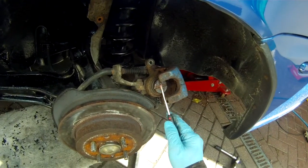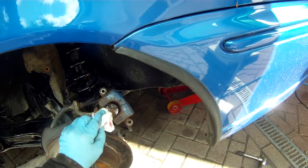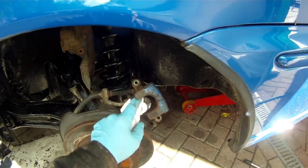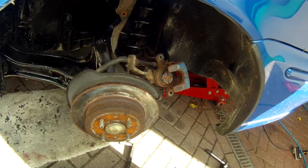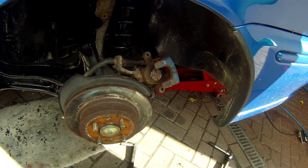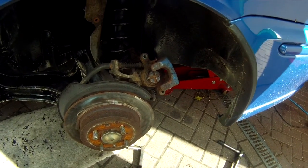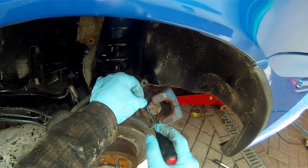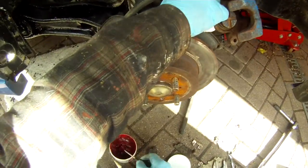On the question of the caliper — if it's stuck you could completely remove it, push down the brake pedal to push it out. See one of my other videos for lubricating and freeing up a brake caliper. For the moment, although it's quite stiff, we're just going to try and lubricate on the inside and wind it back in. Push back the rubber to start.